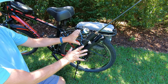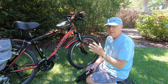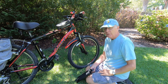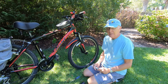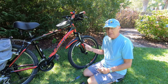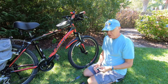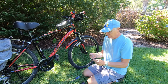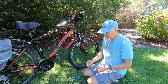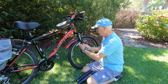If all the issues of mounting in the rear concern you and you don't have a rear rack, you can always mount it to your front fork. One issue you may run into when mounting to the front fork is that the large clamp isn't large enough - that's the case for me - so I've gotten a slightly longer bolt to span the gap. It's a very simple installation.